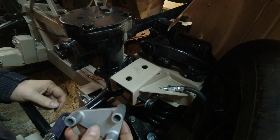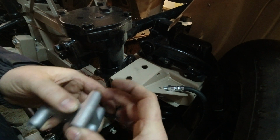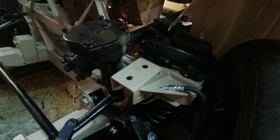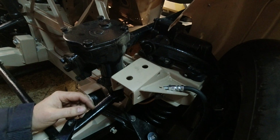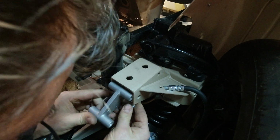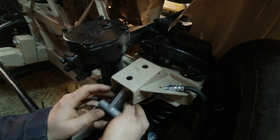So I hadn't put the steering column in properly because this piece, the old one, some of the edges were rotted away. And it's a spacer, so there's pressure on this. So I wanted to make sure that it's good, you know, because it's on the steering and stuff. What I'm doing is, you have to remember that nothing just goes in place. So I'm slowly sanding the spacer down till it fits correctly. Luckily, it's easier to make things smaller than bigger. So, bit by bit, that one's good.